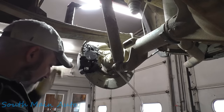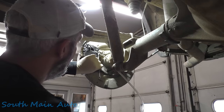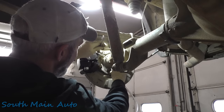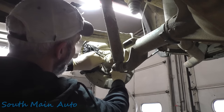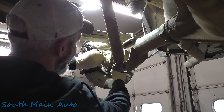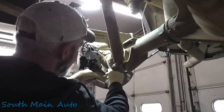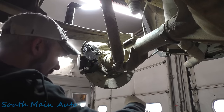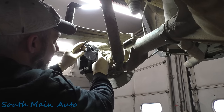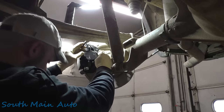This right rear looks pretty clean now. Pretty clear. So this one should be good. I just don't want to have to do the process over again. Typically you don't have to. Usually it's kind of a one-time deal, as long as you haven't been up there just pumping the crap out of the pedal, you know, getting everything all whipped up and foamy. That's been my experience. You just leave the pressure pot on there, let it do its thing.